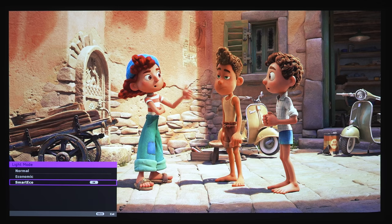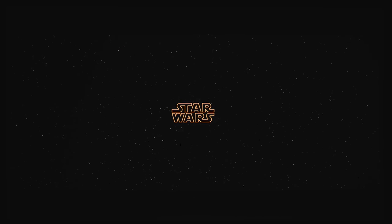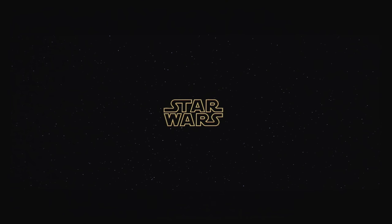And under Light Mode is where you can turn on and off the dynamically dimming light. Now, if you want the laser dimming to work properly, you're going to have to put it on Smart Eco. For this scene here, if you keep your eye on the overall brightness of the screen, once the Star Wars logo fades off the screen, the overall brightness will continue to remain the same. If we switch over to Smart Eco, as the Star Wars logo kind of fades into the background, you should see the screen dim down right there and get even dimmer and then brighten up when episode 9 pops up.